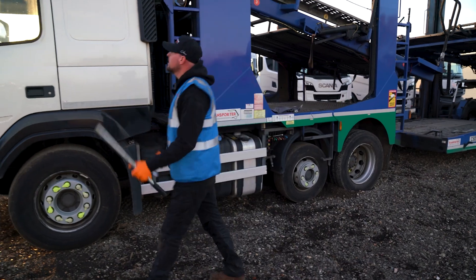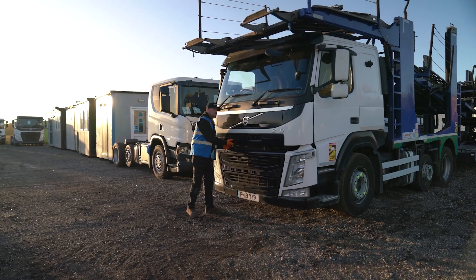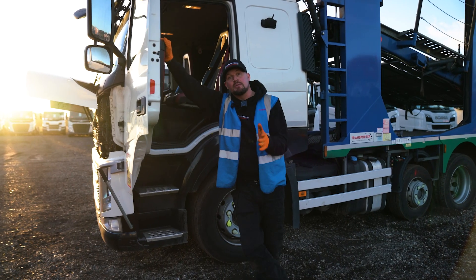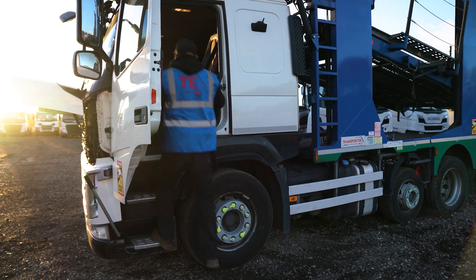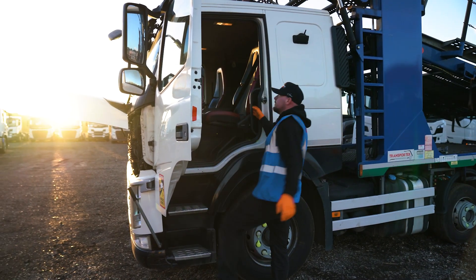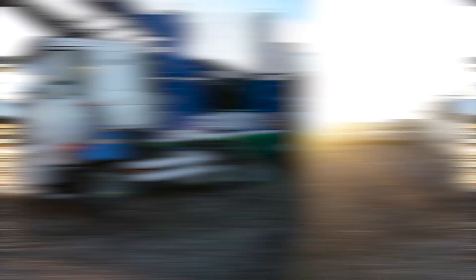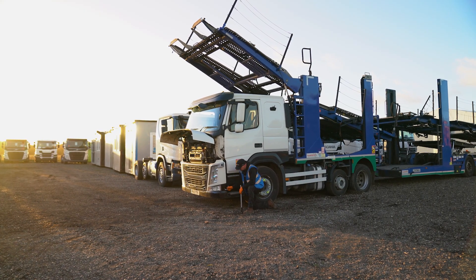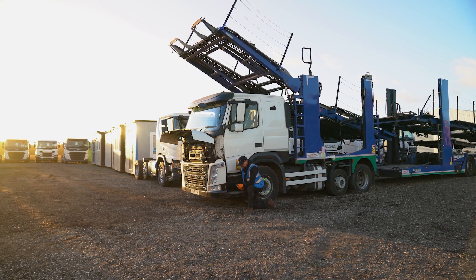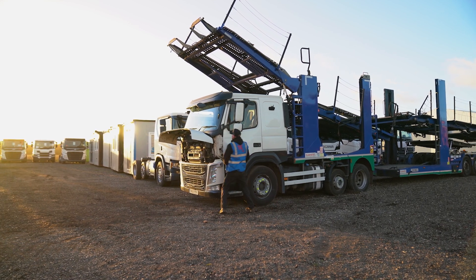So that's our peak up. Now we're going to tilt the cab over. We pop the grill and get that up out of the way. Of course, before we tilt the cab, it's absolutely paramount that we check inside — make sure there are no TVs, microwaves, or anything that's going to come forward and smash the screen once the cab goes over. We turn our cab pump tap around to lift, put our socket on and our cab bar, and we tilt the cab.